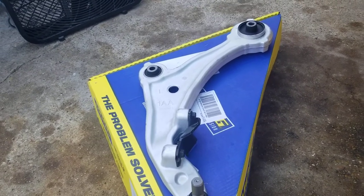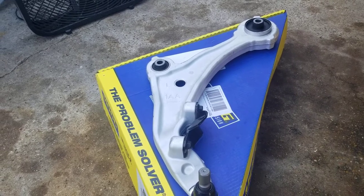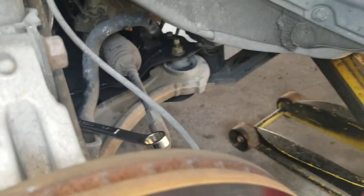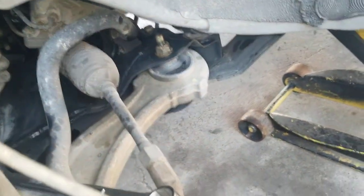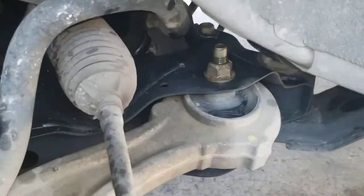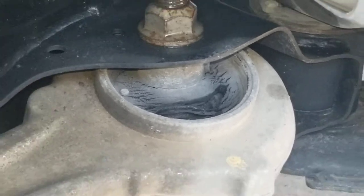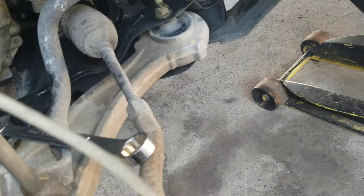When you're driving this thing down the road and you put the brakes on, or you toggle the brakes and bumps combination, it goes clunk, clunk, clunk. That rear bushing back here is pretty toasted — that bushing is all messed up, and that's the one that's making the noise, clunking and clattering around.